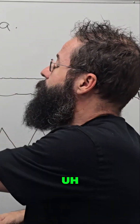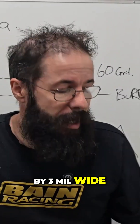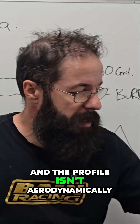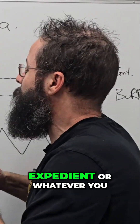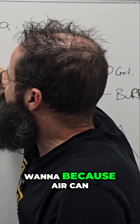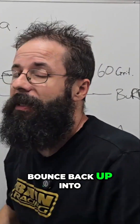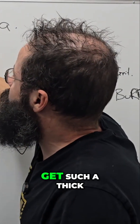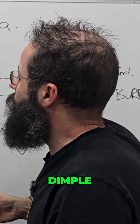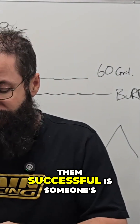If we look at a dimple, they're about half a mil deep by three mil wide, and the profile isn't aerodynamically expedient — air can collide into here and these molecules are gonna bounce back up into the stream. This is how we get such a thick boundary layer with a dimple port.